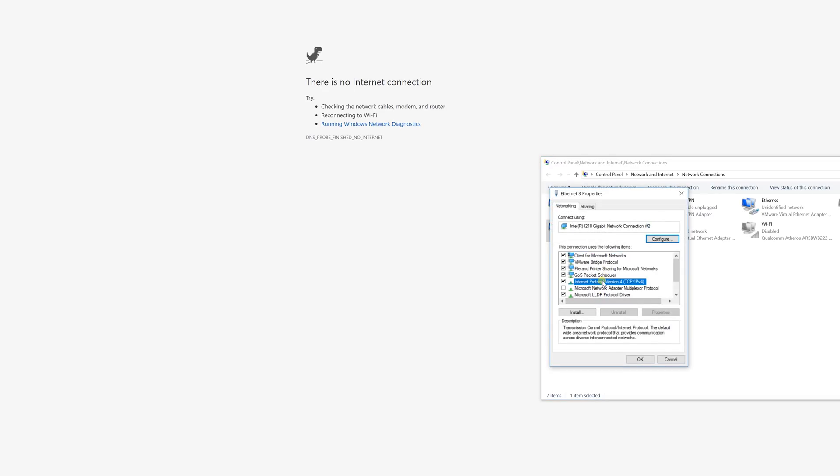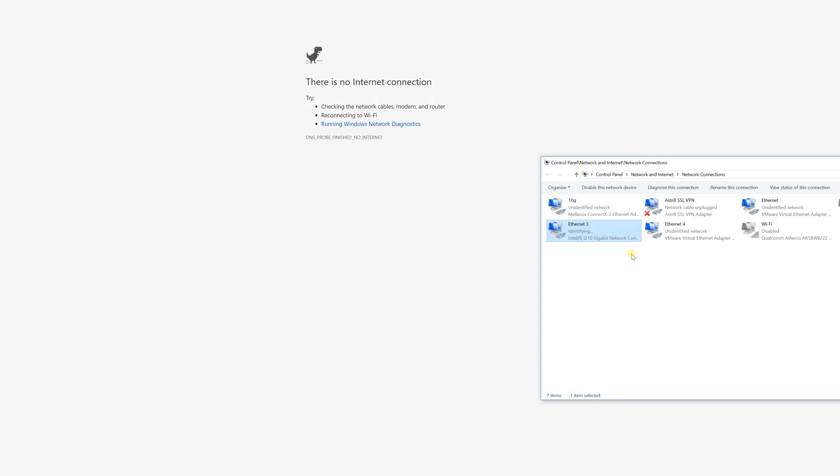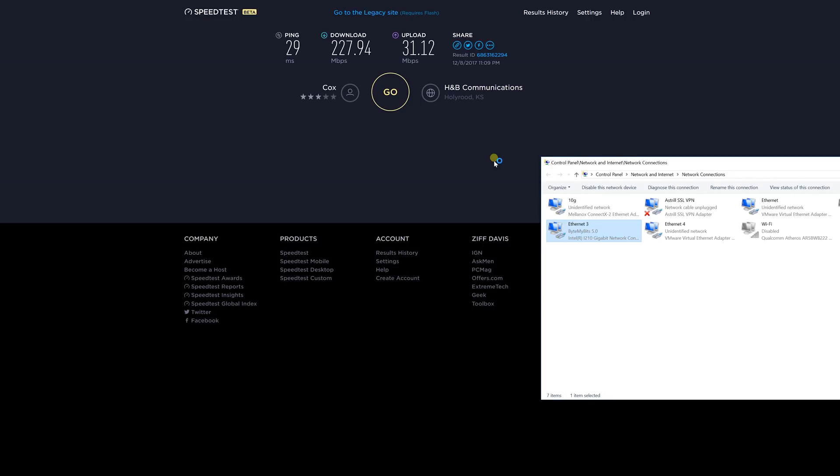You might actually have to do this. With the Linksys router, in order to get a stable, reliable connection through a wireless bridge, I did have to go into my interface properties and manually select an IP range that fell within my normal router's IP subnet — something like 192.168.2.154. When you're connecting through a wireless bridge router to router, you can have some issues pulling DHCP from your original router. It's hit or miss. In the end, if you want a reliable, stable connection, just manually set your IP address.